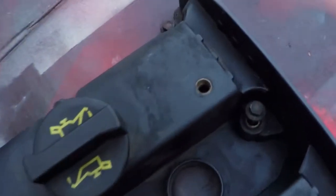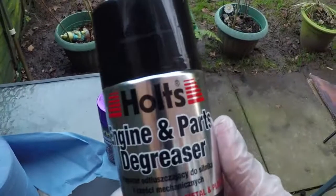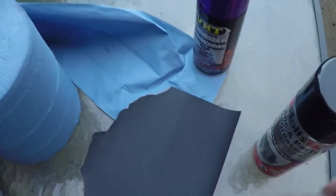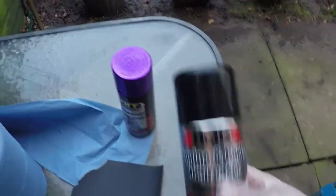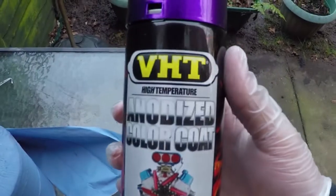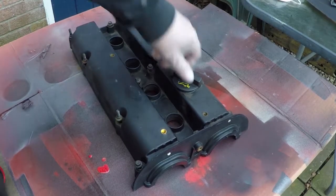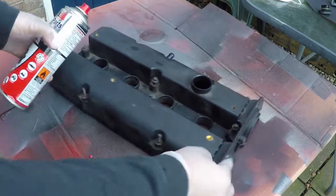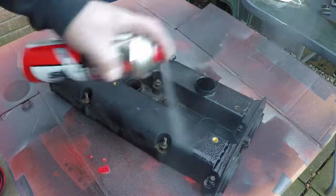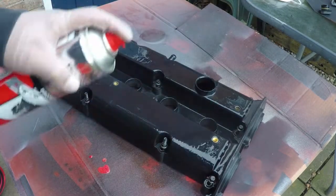I've finally got the rocker cover home - there it is, it's a bit of a mess. My plan is to clean it up with engine degreaser and part cleaner, then sand it with 600 grit sandpaper, clean it again, and then start doing light layers of anodised purple VHT spray. First I'm going to take off things that don't need to be sprayed and then just start hitting it with some degreaser, soak for a couple of seconds and then start wiping it off. I might have to do this a few times because it's really dirty.